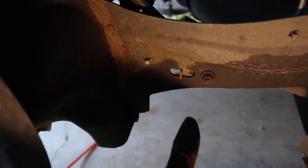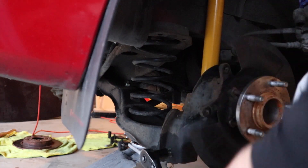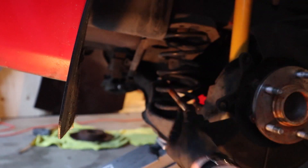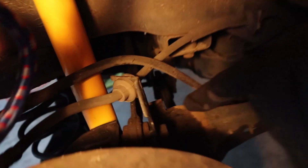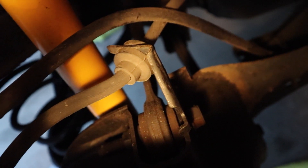There are two bolts up there holding them into the chassis, and you got a couple other miscellaneous bolts - this one here, this one here, this one for the brake clip, and this bolt that attaches to the lateral link. I'm going to take those off and attempt to get the trailing arm off. Then I'll take off this bolt that holds the upper control arm in place. As you can see it has a bushing in it also, so we sprayed that down a couple days prior to make sure it hopefully doesn't seize on me.